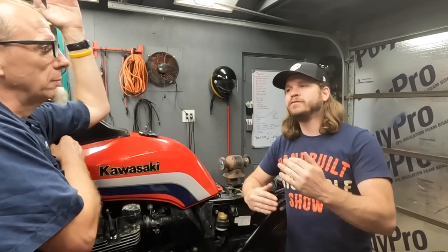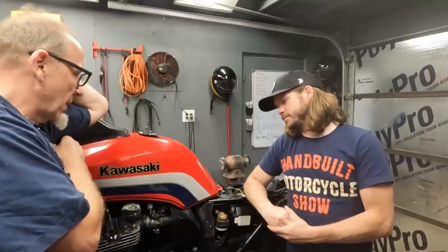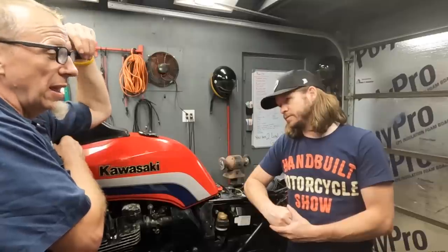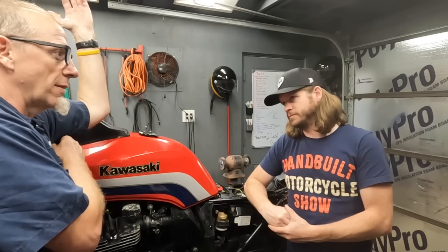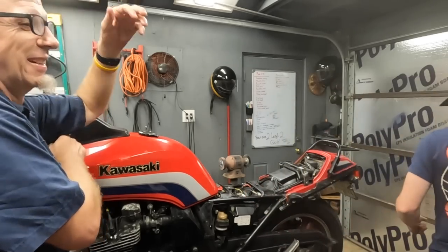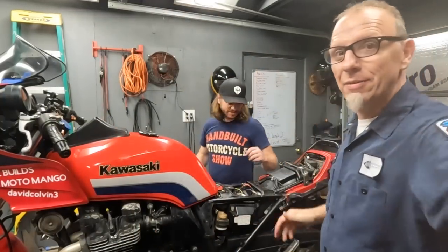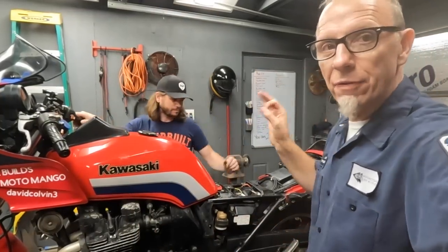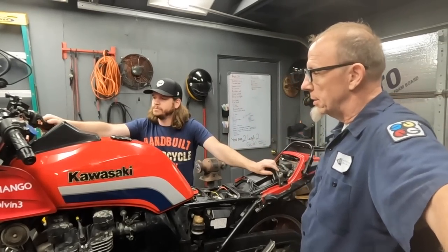We're right around the corner. By assessing the level of metallic in the oil, doesn't seem excessive given the history of the bike. To be honest, it was metallic and not rust, so I'm happy. Yeah, it's cleaning itself. It's exfoliating. So that's what we did, as of right now. Now, we'll ride it around the block and see what it does.